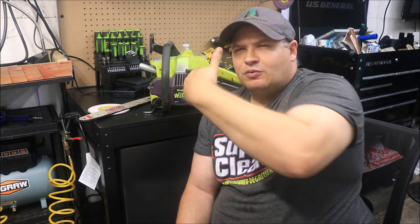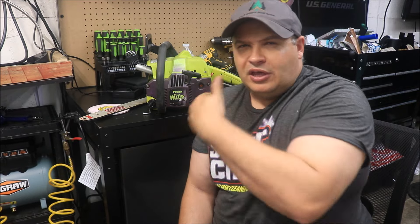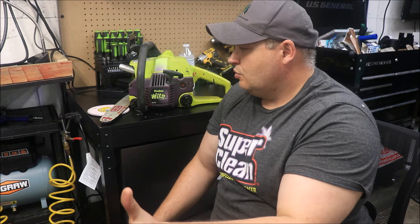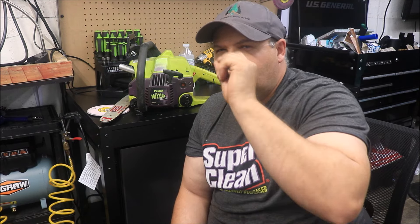Hey guys, welcome back to the channel. Today we're going to look at the little saw I built a couple years back that I've really not looked at in a while. I pulled it off the shelf a few months back and the thing never did really run right — probably ended up having to redo the engine. I had one of those big stupid banana pipes on it and it ended up wallowing out the bolts on the Chinese cylinder. Some of the Chinese cylinders are nicosil or chrome plated — I think this one was chrome plated. It's converted to alcohol and running a big 372 XP carburetor.